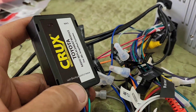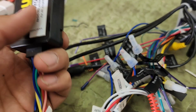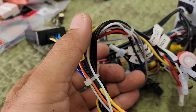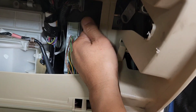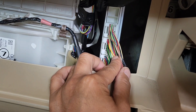That's the only one that will work. What happened is it turns on the JBL amplifier system — that's what gets the sound. It's a digital turn-on. I checked the amp — it looked like an amp but it's a smaller version. It looks like an amp back here but then I realized it's not an amp because an amp would have a heat sink around it. I was thinking about bypassing it, but I decided I better install it the right way.